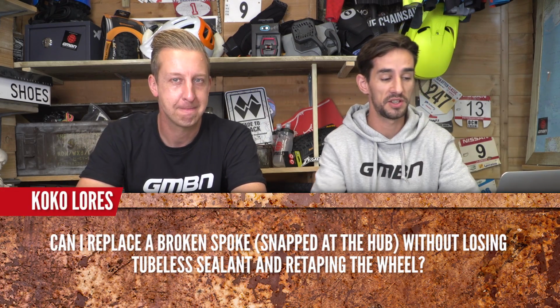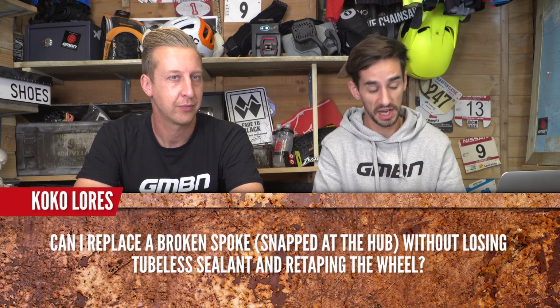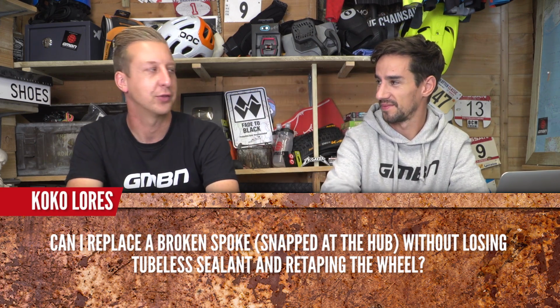Right, Coco Lores says, how can I replace a broken spoke, it snapped at the hub, without losing tubeless sealant and retaping the wheel? Ooh, that's a tricky one. I'm not even sure that's possible without a severe amount of fettling. I think you've got to take the tyre off. You can't really access the nipple properly, can you? No, you can. You don't have to lose the sealant. I scoop it out and you can reuse it most of the time, as long as it's not too old. But I think you're going to have to retape the wheel. Yeah, for sure. So unfortunately, a bit of fettling there.